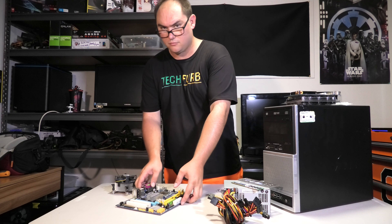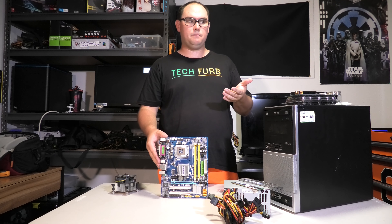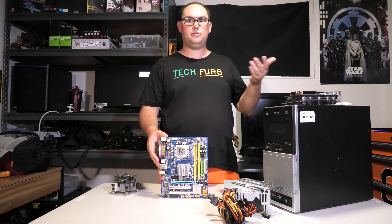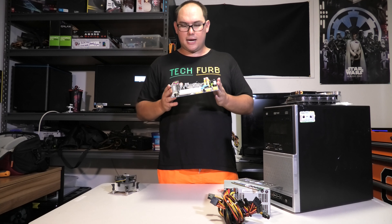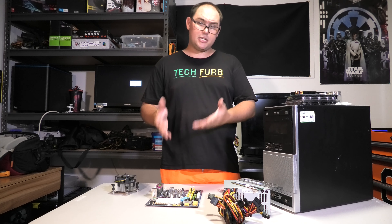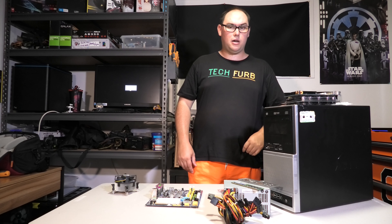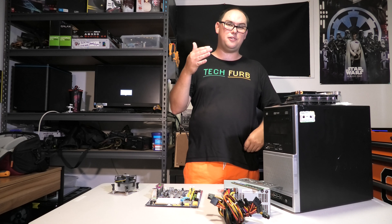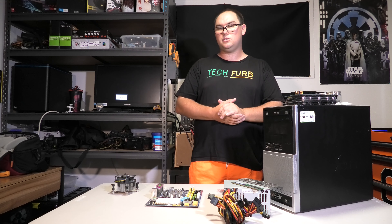The motherboard I went with back then was a budget low-end board — this was like the H310 of the time. It was a Gigabyte G31M-S2L, a fantastic motherboard for the time at around $100-something. It took my dual core chip and you could actually put quad core chips on it, though the VRM wasn't great so I wouldn't recommend overclocking a quad core on it. With my Pentium Dual Core I managed to overclock from the stock 2.5GHz right up to 3.75GHz in Australia in the middle of summer when it's hot. It overclocked like absolute snot.